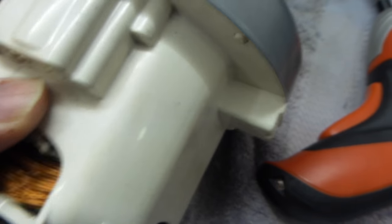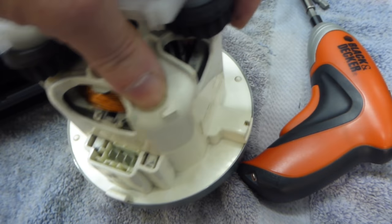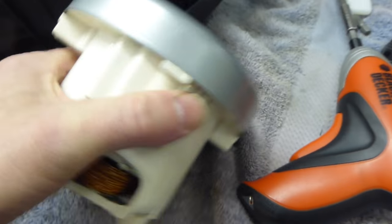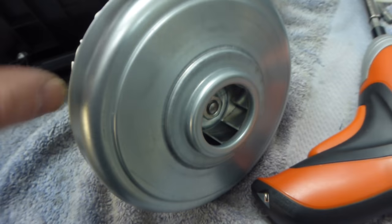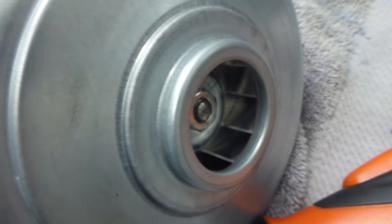The carbons are just in here on one side, and there are the windings. We can take this casing off the back — that's the motor restrainer. It's got two rubbers that just pull away. There you can see the rear bearing, so if you wanted to grease or oil your bearing you can easily get to the back one. The front bearing requires taking off the fan case, which would also give you access to clean the fan if your bag had burst. On mine it doesn't need it because I've always used the right bags.